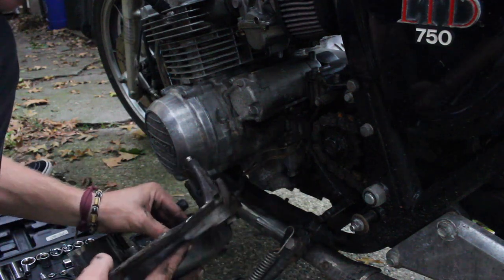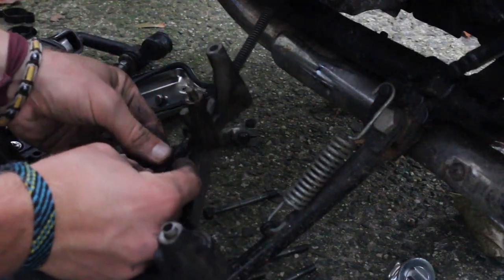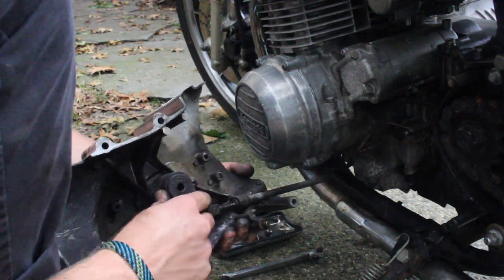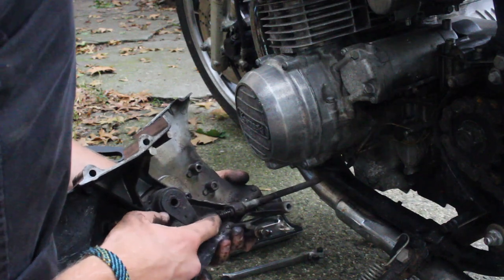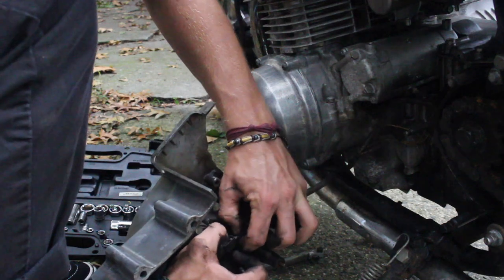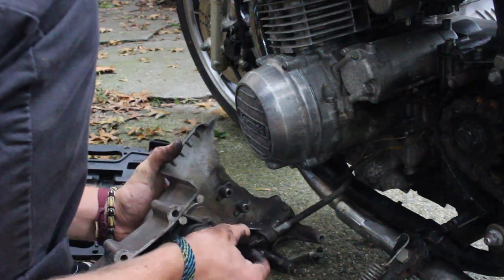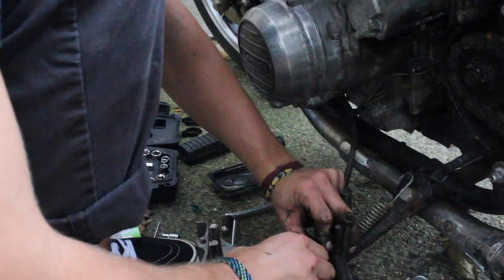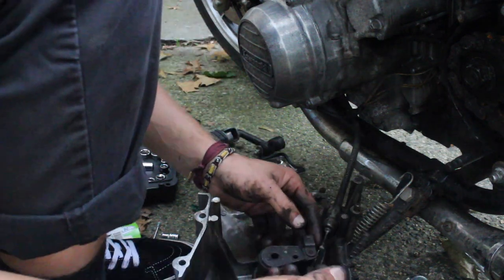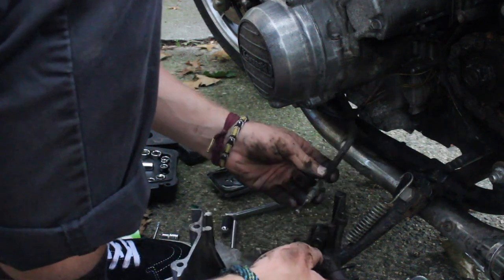Once you've got it off, check out this old clutch cable right in here. After a couple minutes of struggling I got the cotter pin out, which is right behind the cable. Now once you get that out, pull back the spring, push the cable towards the back of the casing, and then lift it out. Ten minutes later — finally got this thing out.